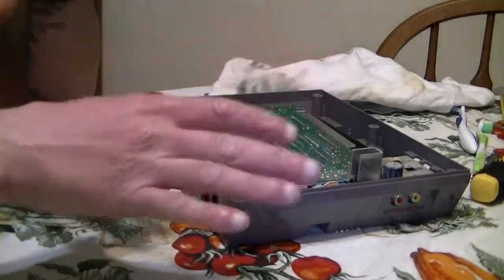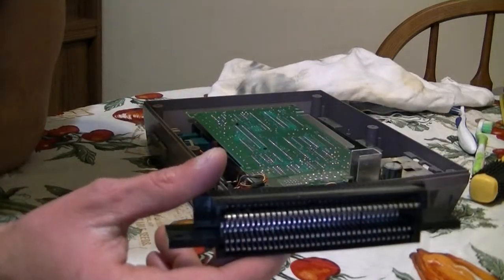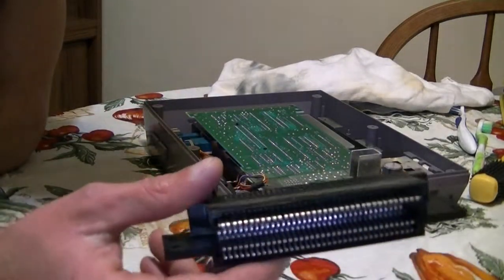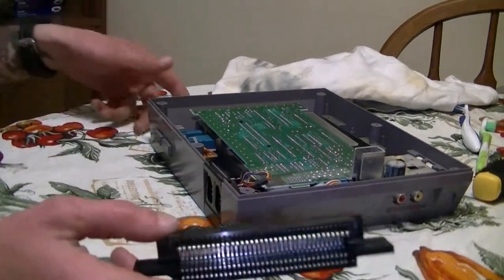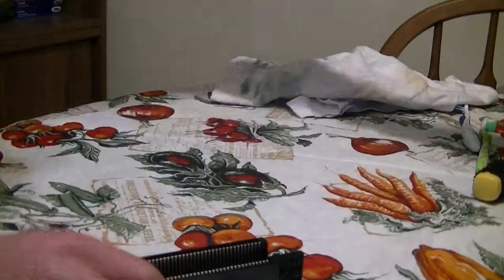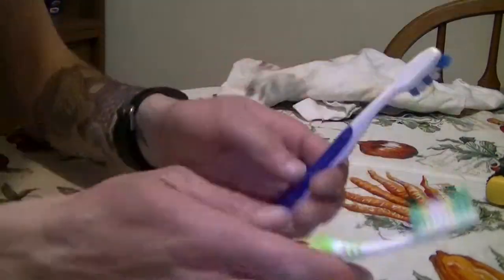Now, in this area, you can go either way. You can either remove this and put a brand new 72-pin connector. eBay sells these for about 10, 15 bucks. They're pretty cheap. But I didn't have time this time to buy a new one. So what I'm gonna do is show you guys how to clean these so they can read games better. You're gonna need two toothbrushes,